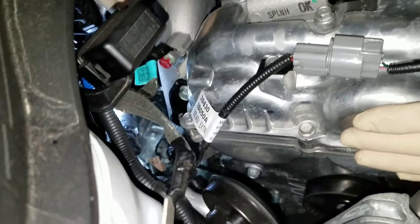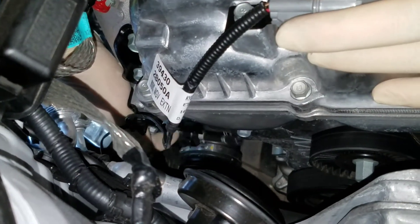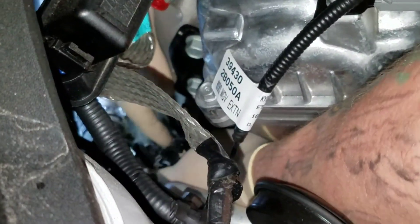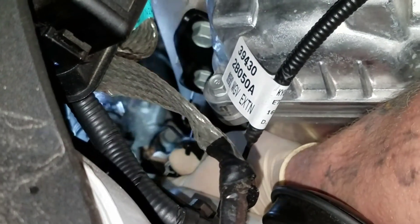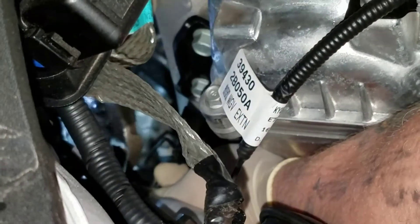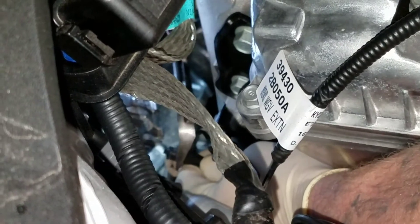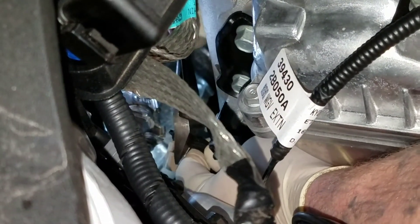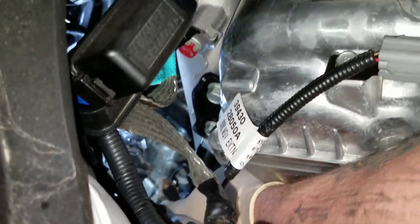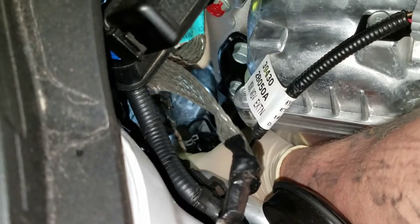Next, here's how we deal with this broken piece. You've got this little broken piece right here in the end of the hose — it's okay. Use a set of side cutters and just cut about a quarter inch off of this. They use some sort of glue on this particular fitting from the factory, and I can never get these off without breaking them. So just clip that off, cut that little piece off, and then spray a little lubricant on that hose so we can slide it in.